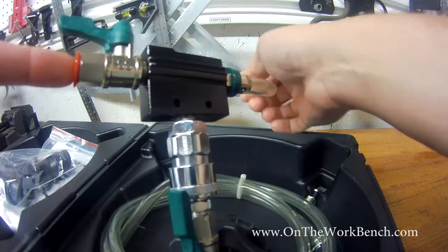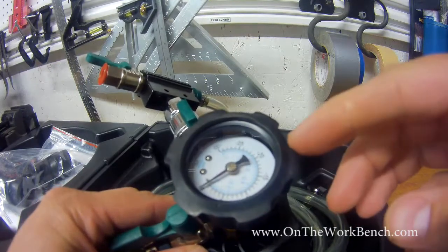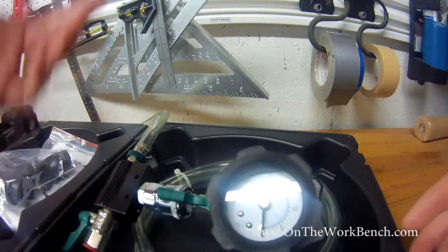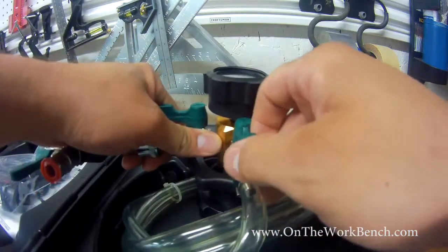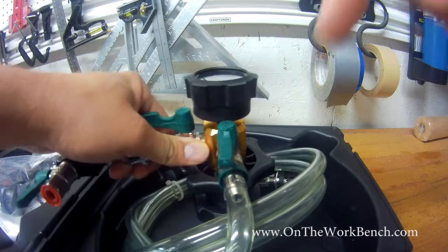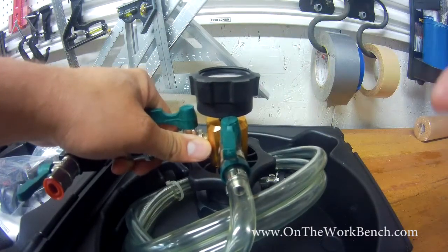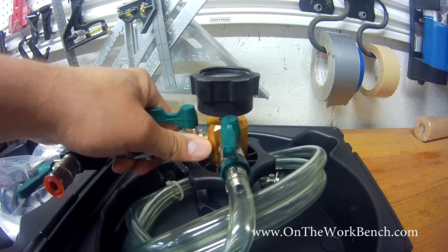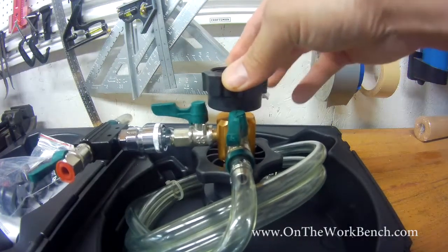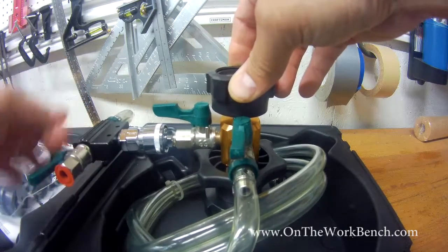That vacuum will suck the air out of your cooling system and hold a vacuum. Since the cooling system operates under pressure anyway, you want to get it down to about minus 20 to minus 25 on the gauge. After you get it under vacuum, you open this valve up here to then suck the coolant back in. That suction brings the coolant in so you have no air locks in your radiator or any part of your cooling system, allowing you to do a better job of your coolant flush and fill.